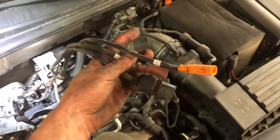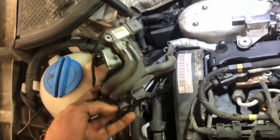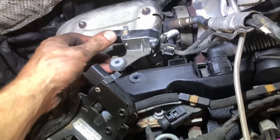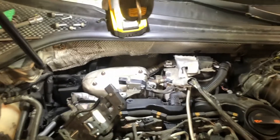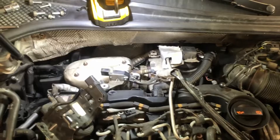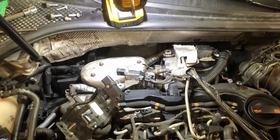Here are the three sensors we just undid. I removed this entire bracket — it's got two bolts facing downwards — so the whole DPF differential sensor is off. Now all I've got is a tiny Allen on the V-band clamp and a 13mm head bolt down there, plus two on the bottom I already undid. That should be everything holding it on, so hopefully it undoes nicely and falls out.